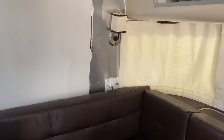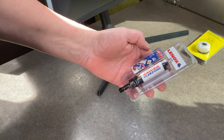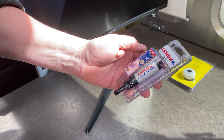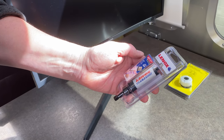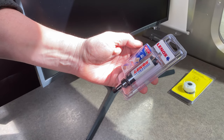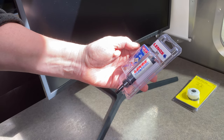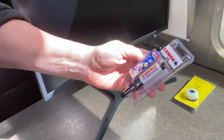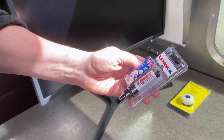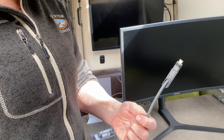This is the hole saw I'm going to use to cut through the Airstream subfloor — just a 3/4-inch hole saw bit. I estimate the subfloor is probably 3/4 inch, certainly not a full inch. I've decided to come up through the belly pan into the Airstream rather than from the Airstream to the outside, because coming from the outside down might bloom out or create unappealing blisters. Also, Fred and I weren't sure we could get the drill under all that electronics equipment anyway — so it's easier from the outside.